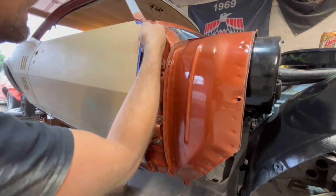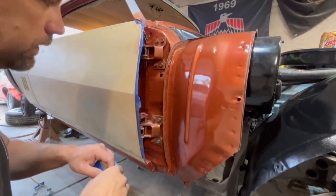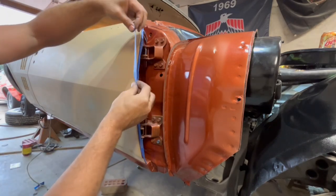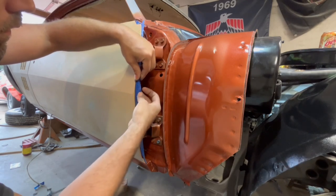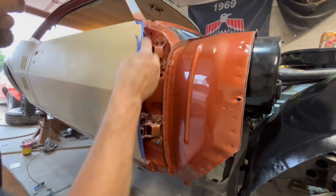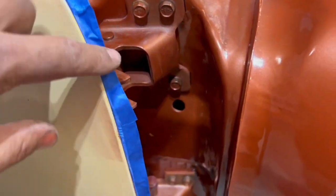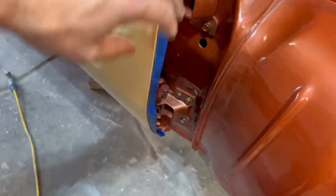Here's what we got to do: we've got to get paint on the leading edge of this door, but I don't want to blow all the paint deep inside the door jam and mess it all up. So the idea is this way I can hit the door jams and it'll work out pretty good. This is the tape — this is the other piece, sticky to sticky. Line it up about like so, and I'm just going to fold this over. You can see that'll keep folded back and stick. Then when I open and shut the door — kind of like a little flap — it'll help prevent the paint from going inside the door jam. Now what that looks like up close — you can see the tape is folded over. It's not the sticky side hanging out. So as the door opens and shuts, it's flexible. It won't stick to the fender, but it should be out far enough to lay up against the edge of the fender and fill in our gap. That's going to work out really nice.